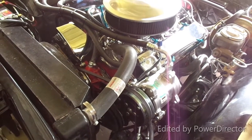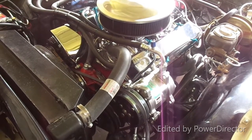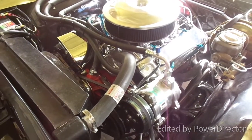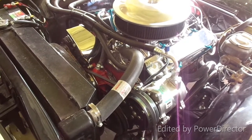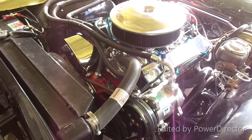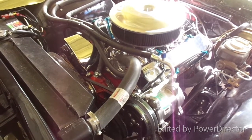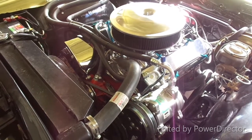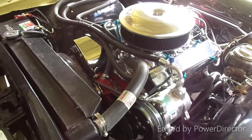I was going to order a 100-amp alternator, but I vaguely remember when doing the wiring they said a 100-amp would need a thicker wire, which I didn't install since I didn't plan on running anything that massive. I stayed with the wiring Painless sent and I'm going to bump it up to an 85-amp. It hovers around 12 volts, down to maybe 11.8 or up to 12.6. I already ordered the 85-amp — hopefully that'll cure the problem.